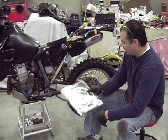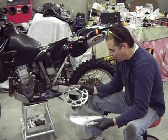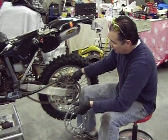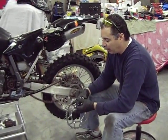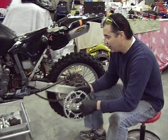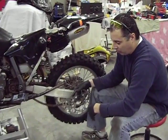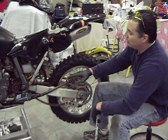After careful consideration, Everide — we hope you like it — we decided to get an Outlaw Racing Products rear sprocket. This one has a 47-tooth rear sprocket. We thought because we're adding racks and maybe more weight, it might be good to have just a little bit more gear ratio. So we actually went with a 48 instead of a 47 — it's just one tooth. You're going to lose just a little bit of top end, but not radically so. So we're going to put a 48 on the rear, a 14 on the front, put the new chain on, get everything adjusted. It's going to need some wear-in time, and then the back end of this bike will be done.